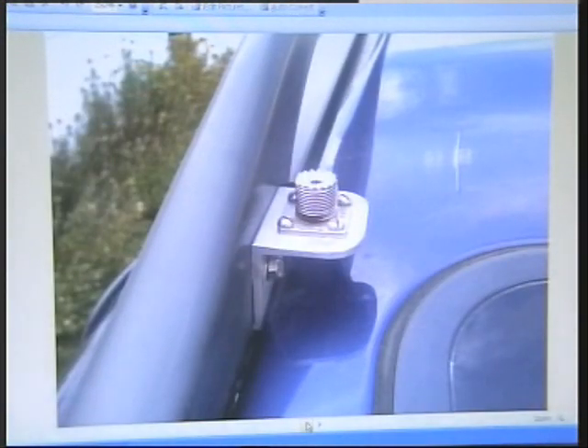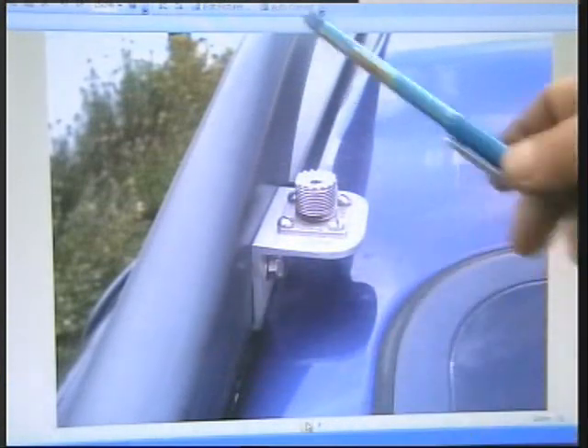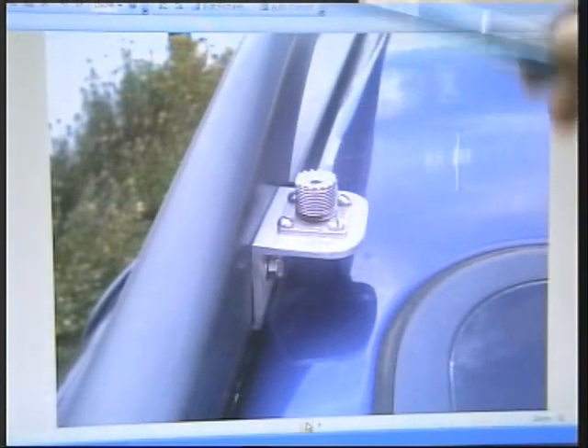While on the subject of 2m — again various things I'm deleting, just thought I'd show you. This is my aerial mount on my car. It's for 2m vertical, and it's an SO239 socket mounted on a small aluminium bracket I made up. It's an extremely neat arrangement. You might say, well, so what — but like a lot of simple things there's a lot more to it than you first imagine. First of all, from the side view it can't be seen, and because it's lower than the roof rails — this is a roof rail — I can put ladders and sheet supplies on top.